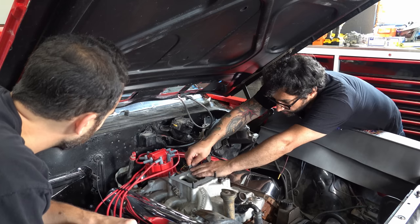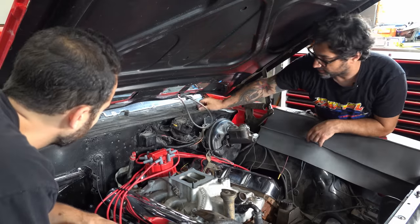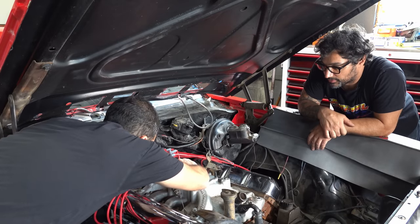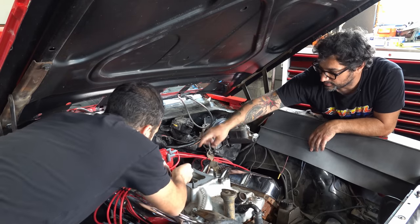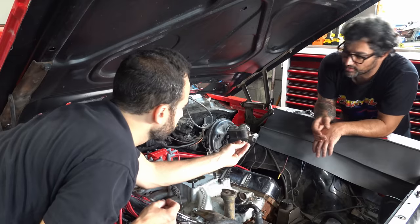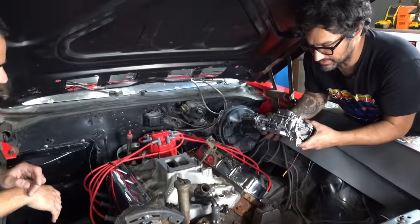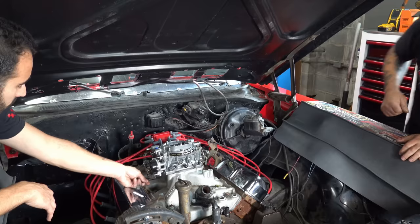Right, in our effort to not spend any money and build this out of stuff we got laying around in the parts room, I'm just trimming out this hole. Both the manifold and the carburetor are dual bolt pattern, so they're 4150 style and spread bore style. But this bracket's only gonna work spread bore style. So we're gonna move these rear studs in. Pro tip, just blow it off before you put it on there. That helps. It's like an 80% success rate when you do that.